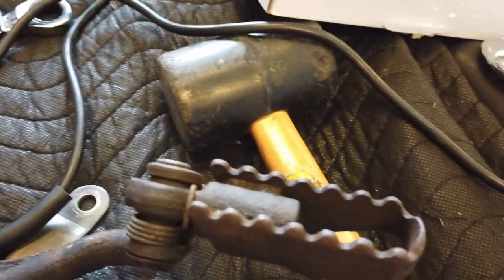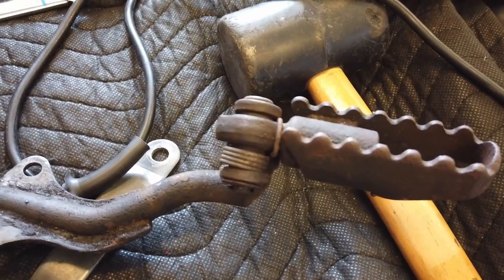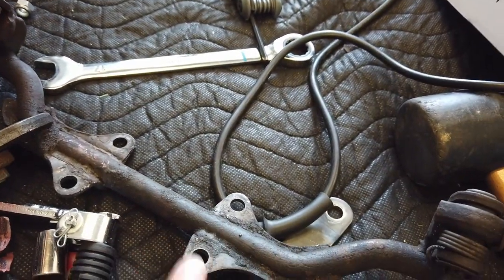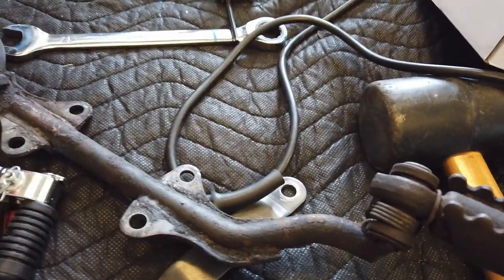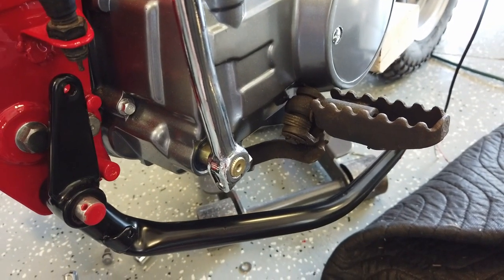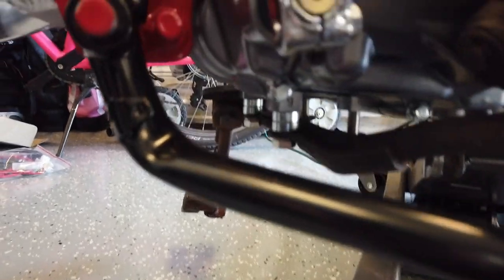What I need is for this to be a little higher so the lever can start up here and the travel can be long enough to pull the brake rod for the rear. This foot peg comes straight out, but I was looking at the original one and it looks like at the point of the pivot it comes quite a bit up - just enough clearance. So I'm going to try to put the original one back on. I should have tried this out to start with, but I thought the other solution was going to be easier and it just made the project a little more difficult.